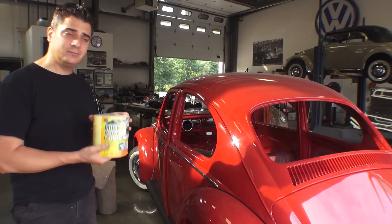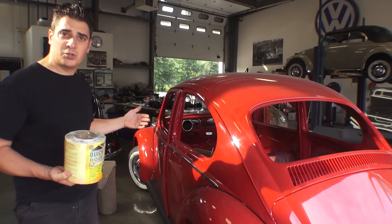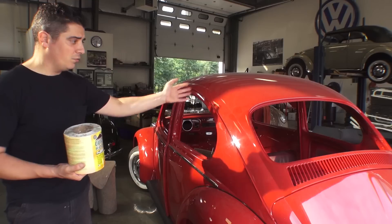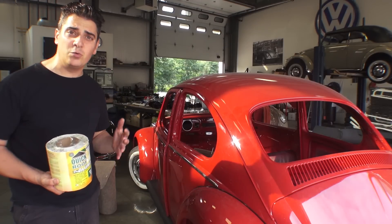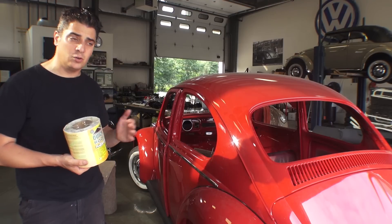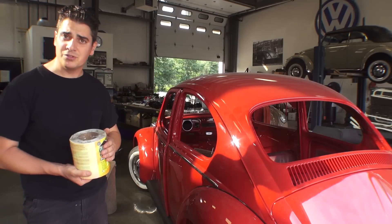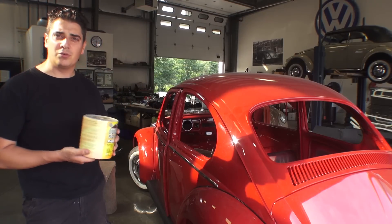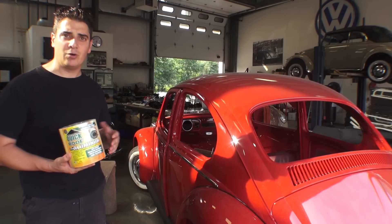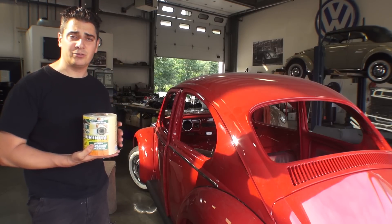So just to recap: Quick Roof, three to five rolls, $16 a roll to do your whole beetle. We're going to do two to three strips in each door, two to three strips in each quarter panel, strips on the back luggage compartment over the wheel humps — and that's really all you need. If you want to go further and put them on the floor pans and the front firewall section, that's good too. But I want my doors to close and sound real nice, not have a tinny sound, and I want to deaden the motor sound. So I can get away with three to four rolls. At $16 a roll, you can't go wrong compared to the high-end products which will cost you into the hundreds of dollars to do your car.